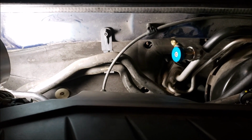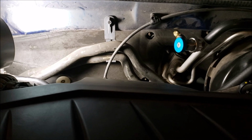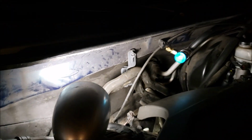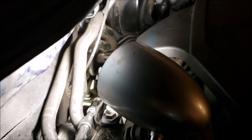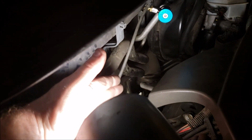See those 2 heater hoses right in the center? Temporarily pop those off, because when that lowers down, it's going to stretch them. And you don't want to break that plastic clip right there. You don't want to break that clip. Now, once you get it lowered and everything, depending on how you undo the high and low pressure lines, you may want to stretch these and put them back up to open this area up.